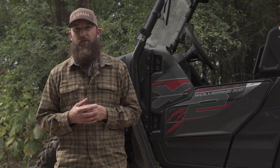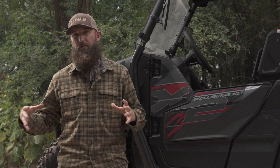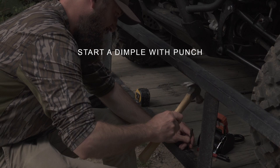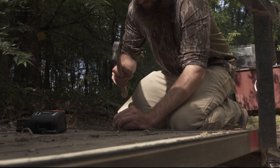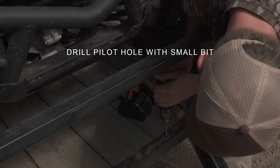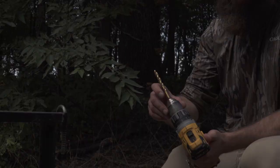If you don't have metal on your trailer to drill through, you can always buy a sheet of metal for each of the anchoring points to help distribute the surface area a little bit more and give yourself a stronger system. In this case, I did have metal to drill through. Regardless, what you're going to want to do before you drill a hole is start a dimple with some type of punch. We used a nail punch and just hammered it to get it started so that when you send that first drill bit through, it's going to be a lot easier to get the hole started.